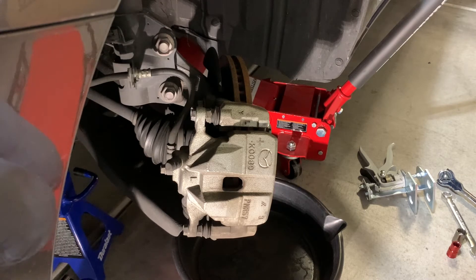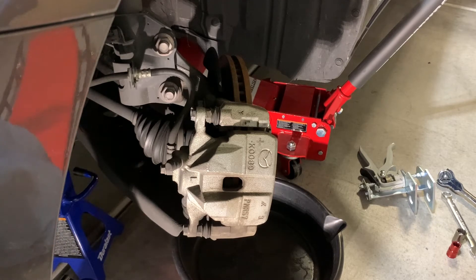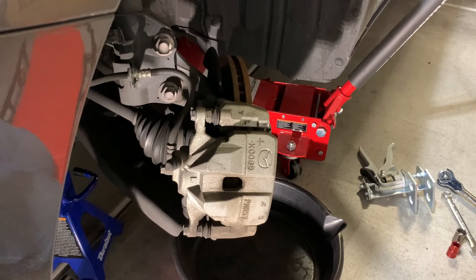What we have here today is a 2016 Mazda 6 Grand Touring. The customer complaint is that the front end shimmies under braking, especially coming from higher speeds — you can feel the steering wheel shaking. These are the original brake rotors, so the customer elected to upgrade to some Power Stop drilled and slotted rotors as well as the Power Stop Evolution Sport carbon fiber ceramic pads.